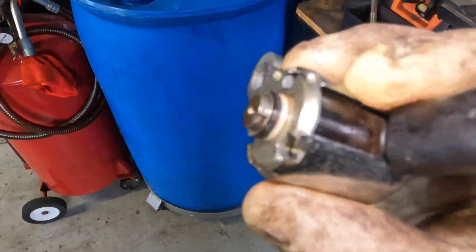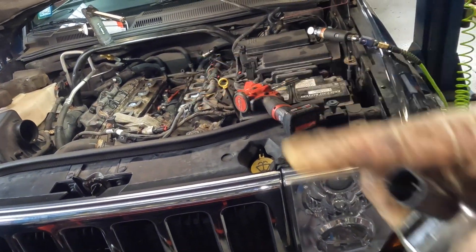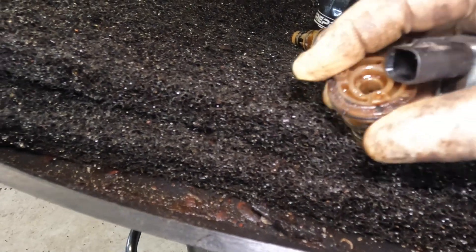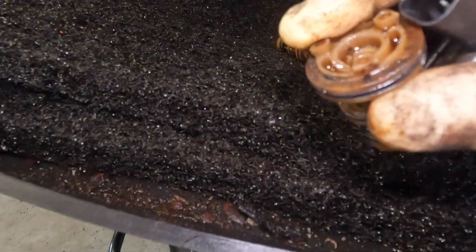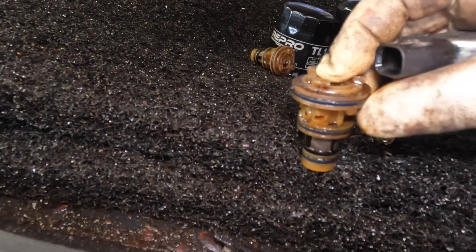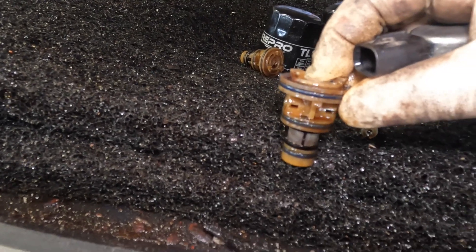You're probably wondering, hey, where's the other half? Well, they get stuck inside the engine, like you guys just saw. So let me show you the halves that are broken. These are the halves that are broken — all they are is crimped onto these little tabs, and that's why they tend to fail. These get stuck inside the engine bore where they live in, simply because of all the heat cycling and everything that goes on there — they have a tendency to get stuck.